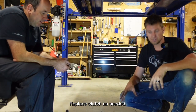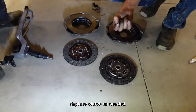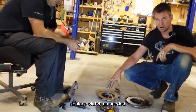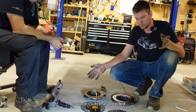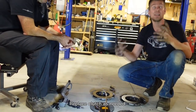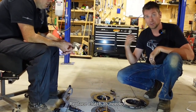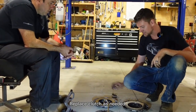We are going to change the clutch after pulling it out and discovering the springs are really loose — we actually found a piece of broken spring in the clutch. Despite the friction material being great, we're still going to replace it. We're going to stick with an OE clutch because of the number of drivers we have in this car. It feels great, works great, shifts amazingly, and there's no real need to put extra load on the drivetrain with a super heavy-duty clutch. This is a pretty cheap component, and as you can see it's extremely easy to remove the transmission and service it every 30 to 50 hours of racing. So we're going to remove the flywheel now, change the pilot bearing in the back of the crank, and then put the clutch back on.